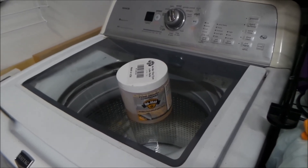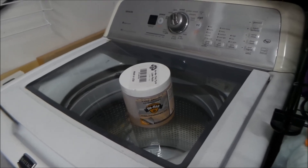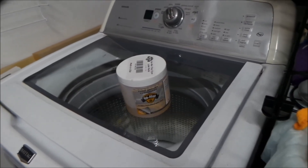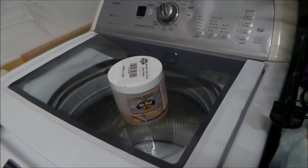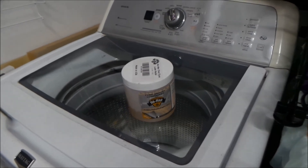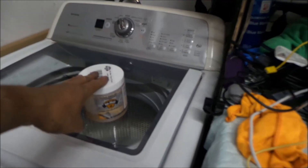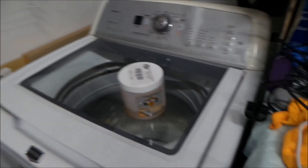It doesn't have any funky smell to it. It makes your hands soft and it should evaporate over time — it just naturally works with the rubber so it's not gonna harm your tires, at least that's what they advertise. So that's the second tire done with this stuff. For the third tire we'll be using it as a spray: two tablespoons in a spray bottle with warm water until it dissolves, and then you've got a tire lube spray.